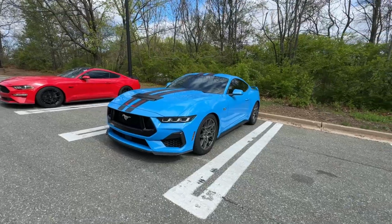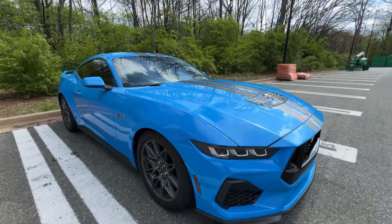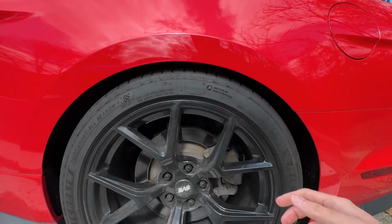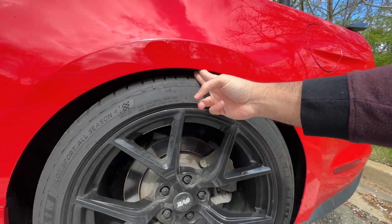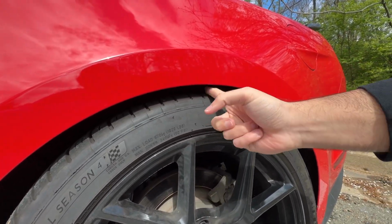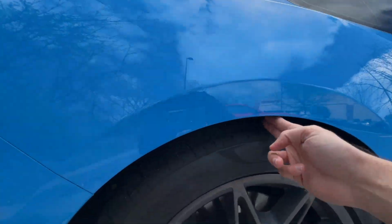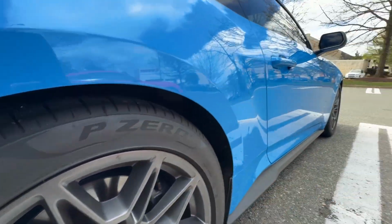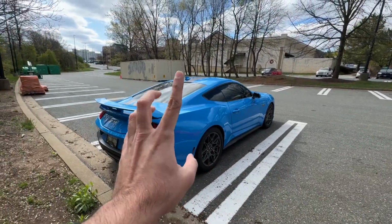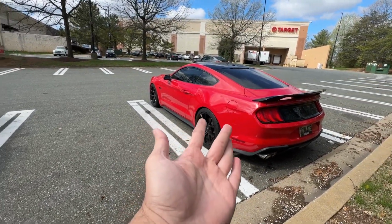So, but let's compare it to my car to see how it compares. So let's go ahead. And these are INSTA springs. This also should be, this is actually a little bit tighter. I can barely squeeze a couple fingers in, whereas here I can pretty much get 2, yeah, almost 3. So even though they both claim 1-inch drop for the INSTA Sport Progressive and the SR Performance, the INSTA ends up being a little bit lower, and that could be maybe my tire setup.